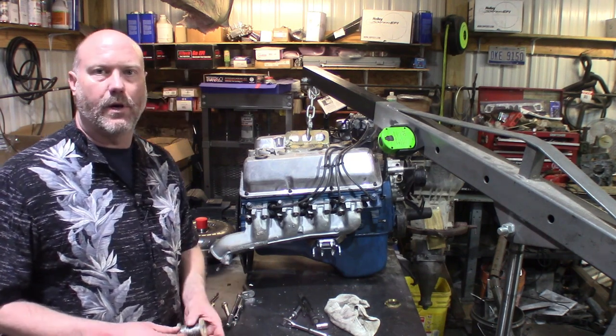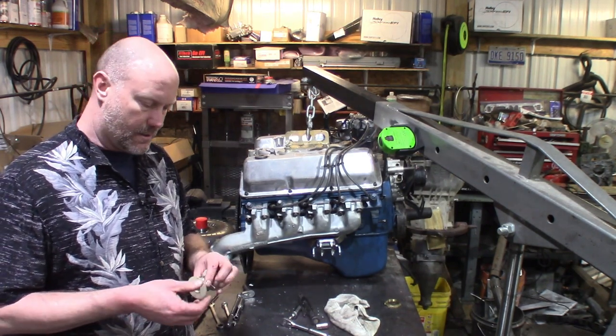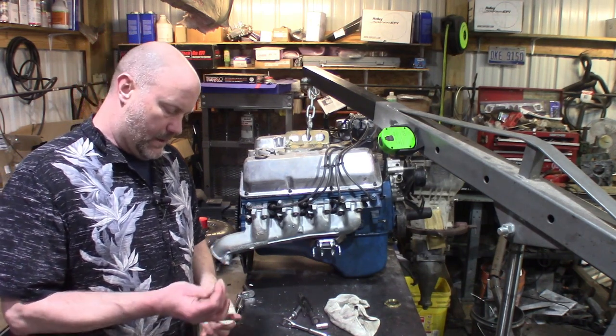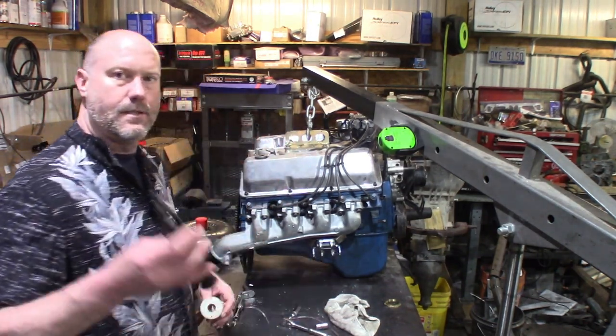I will say that the safety wire method is my preferred method for keeping bolts tight. I don't find anything works as well as safety wire does. This is an old practice that comes off of the aircraft world. What I like to do is take some 32/1000 stainless steel safety wire and safety wire pliers.